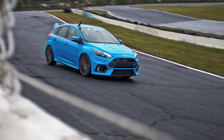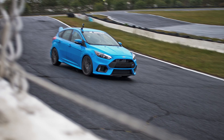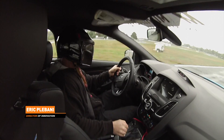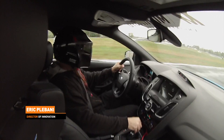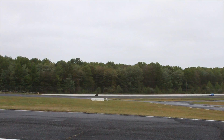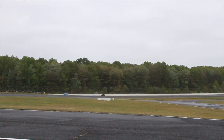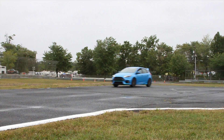We were actually on the track — I knew we were getting 230, 240 degrees on the inlet of the cooler. However, our driver is reporting back to us saying the gauge is nearing 270, 280 degrees. That's really where we started finding that there was a disconnect between what the computer is seeing and telling you versus what it's actually seeing with our kit installed.